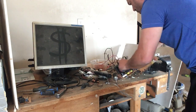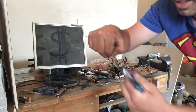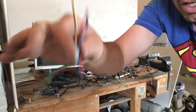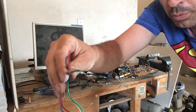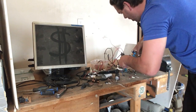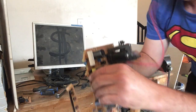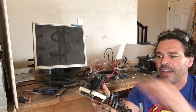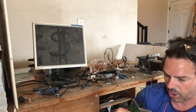You can see there is some more wire here. This wire — I'm going to look inside of it. Sometimes it is aluminum, but this is going to be copper and will be 60% appliance wire, going for $2.56 a pound. The transformer here — I do want to check it. Some transformers have their own category, but sometimes they are better left on the circuit board for weight. If I was to look inside and see a nice spool of copper, then it would be worth taking off.